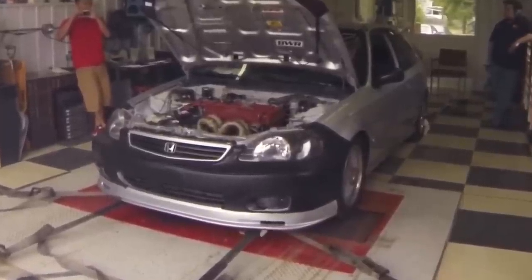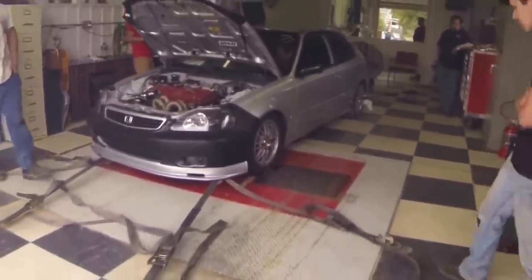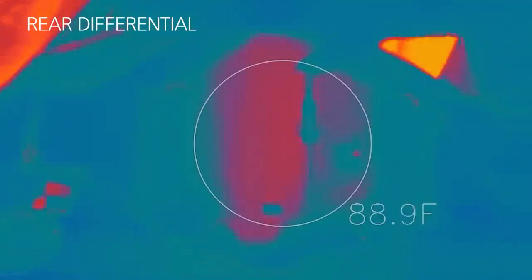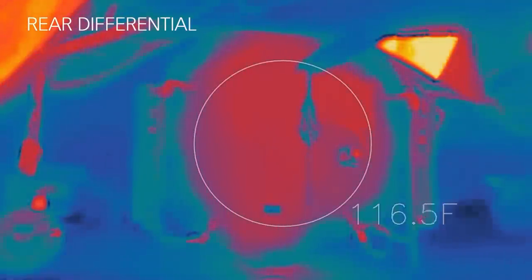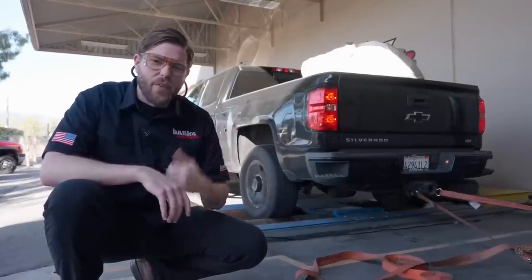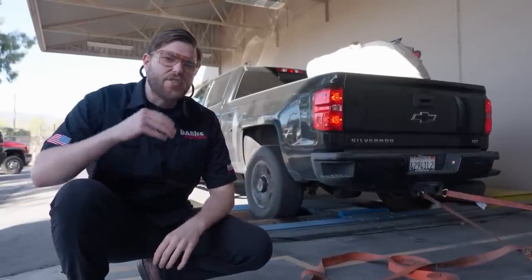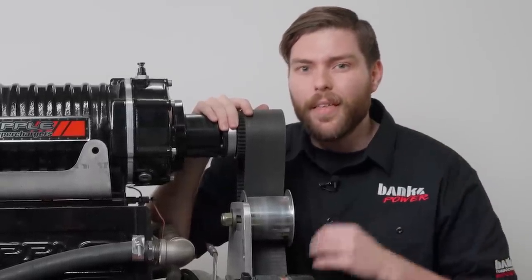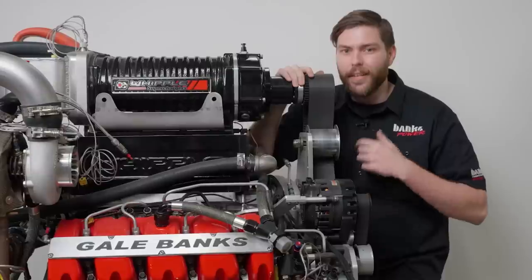The power numbers on the dyno should be as close as possible to what you'll see when you drive on the road. If you buy a cold air intake that was dyno tested with the vehicle's hood up, it's taking advantage of airflow and temperatures that will not be there when you're driving. It's also important to bring test vehicles up to temp. Not only does your intake air affect your power output, but oil in your engine, transmission, and differential all have an effect on power output as well. Testing should start with a thoroughly warm vehicle, and you want to make sure those temperatures stay within a safe range during the test. Engine oil gets thinner as it heats up, so if your vehicle isn't up to temp, the thicker oil would lead to increased drag and parasitic loss, and your torque reading will fall off. Accuracy requires repeatable testing.